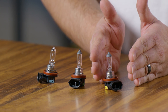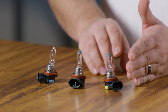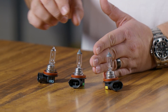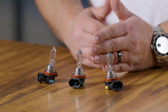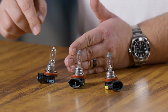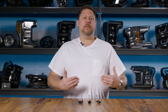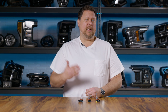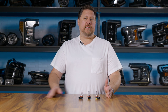You can tell at a glance which bulb you're looking at: the H8 for fog lights is a smaller glass capsule with a painted tip, the H11 for low beam is a slightly larger glass capsule with a painted tip, and the H9 for high beam is the biggest glass capsule without a painted tip. We're going to modify the tabs on each bulb so they all fit in the headlight of this Toyota Tacoma to demonstrate the difference in wattage and brightness — comparing each halogen bulb and an LED upgrade.